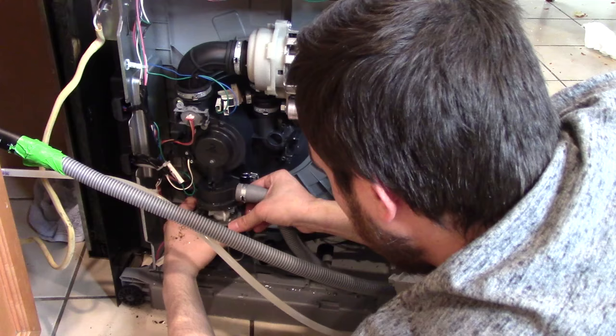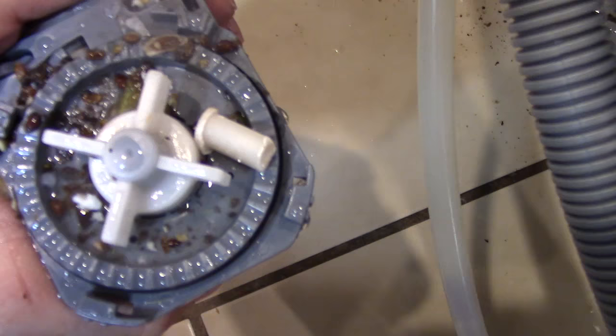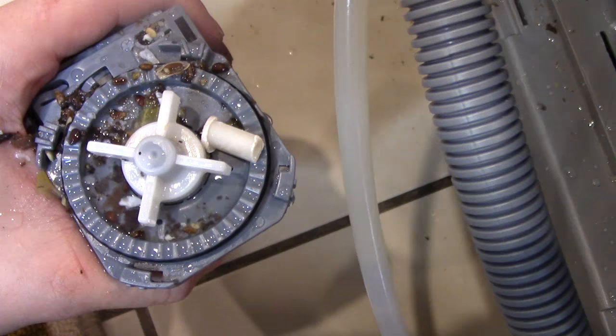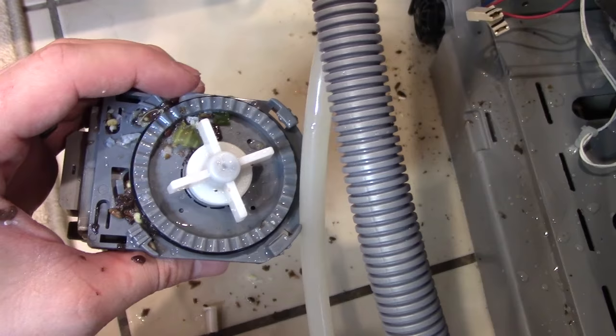Let's just rotate it. Check this out — it looks like there's a little white plastic piece right next to the impeller, and I'll bet you anything that's the thing that was jamming it up. Typically with a motor, if you hear it humming, that means there's electricity going to it. But if you don't actually hear it turning, that means there's something jamming it — and in this situation, I think that's exactly what the issue was. So what I'm going to do now is clean out this thing. It looks like there's pieces of food and some pretty gross stuff in there. I'm going to clean that out and screw it back in, and I'll bet you this thing will start working again.